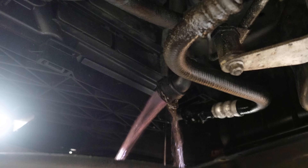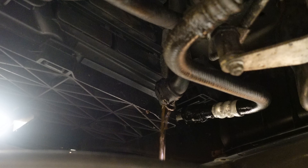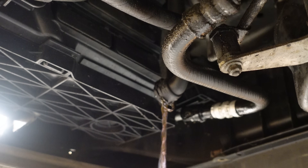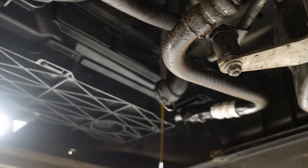Try and keep it out of your face. If you do this on the floor, make sure you wear goggles because of how fast it can come out. The coolant doesn't look too good actually — it's quite dirty and it's red, but bearing in mind this coolant has been sitting for a very very long time. We'll let that finish draining out. I've got the lid off on the expansion tank as well, and that's what you need to do to let it completely flow out — release the lid first so it just flows out nicely.